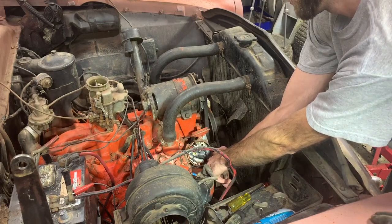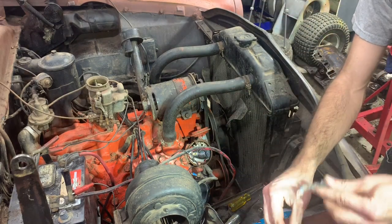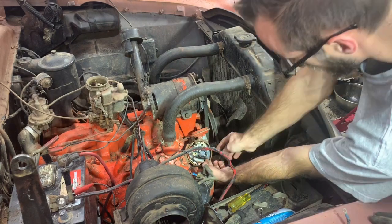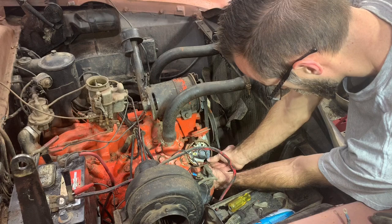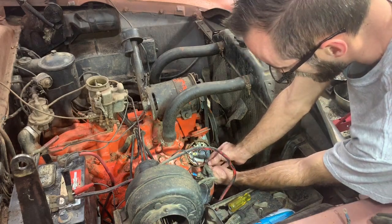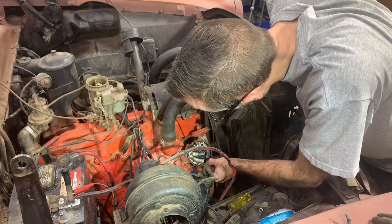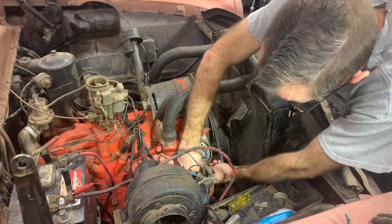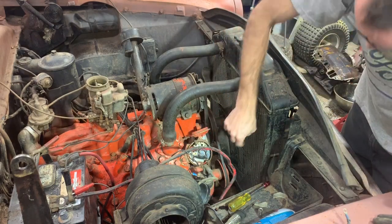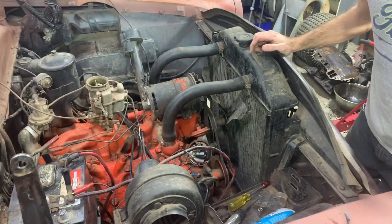The wire coming from the coil up through the base of the distributor was shorting out - that's not factory. The insulation is gone, so we're just going to do a cheater wire to get us where we want to be. This motor is not going to be used anyway. It was just grounding itself out - bolted straight to the bottom of the distributor. So we're going to attach a wire to that and run it - just run a wire from here and drop it down to that hole. That was never going to work.